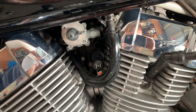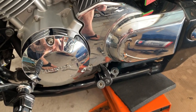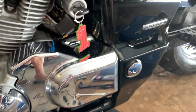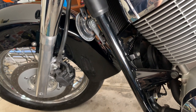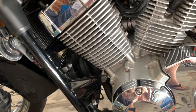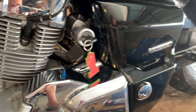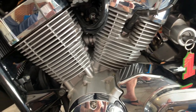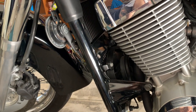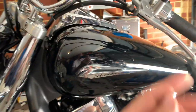That's to make the carb run a bit cooler for more power. That's it for the day — I'm just going to tighten up the spokes. Pretty much done all the maintenance items for this 8,000 mile service, since it's just done 12 and a half thousand kilometres since new. I did the diff oil, lubed all the cables, put a new air filter and spark plugs, done the valves and checked all the hoses for tightness and all the nuts and bolts.